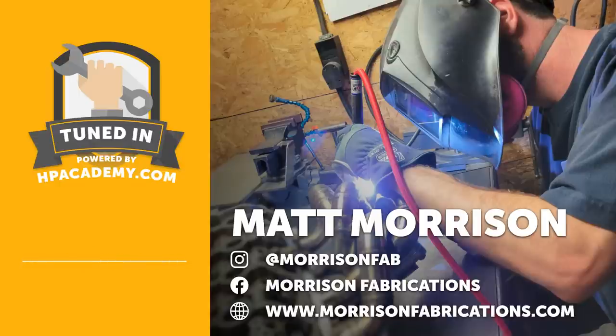It wasn't until around 2010 that I decided to go to a junkyard and get an HX35 off a 2000 Dodge Ram diesel truck. It wasn't uncommon at the time for people to use a bolt-on turbine housing to bolt that turbo up to a stock manifold, or use a standard T3 manifold with that factory divided T3 turbine housing. But no one had really tried the stock divided T3 housing with a divided T3 manifold. So as a good excuse to build my first turbo manifold, I bought the head flange, some mild steel weld els, a wastegate, and used my dad's MIG welder in the garage and just got to it.